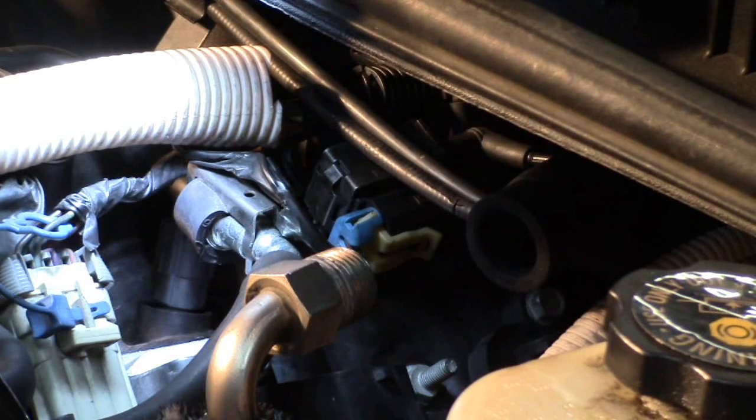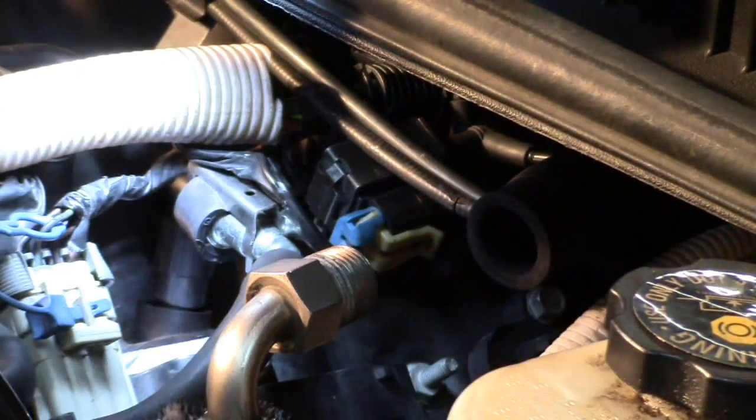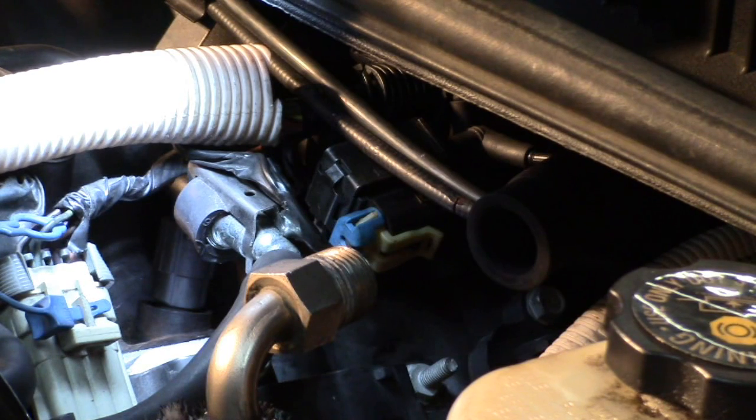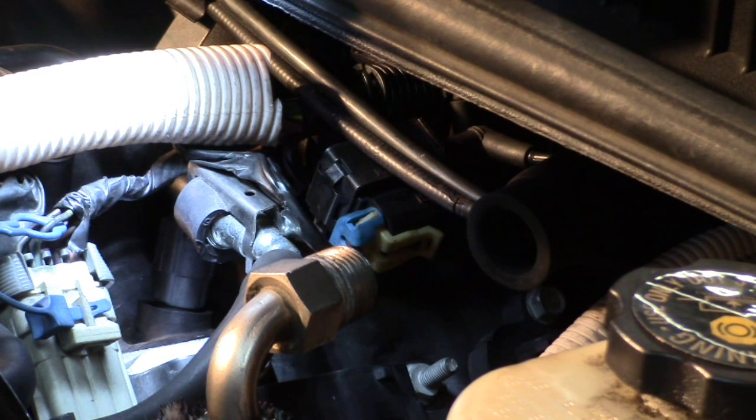With the diverter valve functional, we would also want to repeat the blow test on the other bank to make sure there isn't some issue with the check valve or a clog. But right now everything seems to be working. The diverter valve is not controlled with a hand vacuum pump — it's controlled by this solenoid right here. So the next thing we need to do is test that solenoid. Testing it will involve putting 12 volts to it. I do not rely on a click alone to validate a solenoid; I rely on it actually serving its function, which is allowing vacuum to pass through.